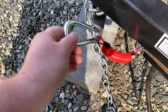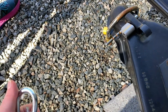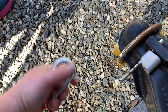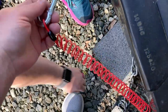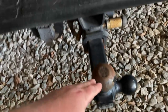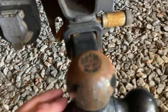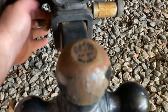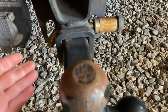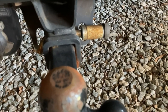You can see it'll just curl right back up. And once you hook your trailer up and hook your chains up to the back of your truck, you'll hook this to the same spot where the chains go. You don't want to hook it on the chain itself — you want to hook it on the spot where the chains go. Here's the hitch — that's where the trailer will be attached. Right here on both sides of the hitch we have little spots where the chains go. Now you don't have to wrap your emergency breakaway cable — it'll just attach right here to where your chain goes. And that way if your chains or trailer come undone from your truck, that'll pull that pin out and apply brakes to your trailer.